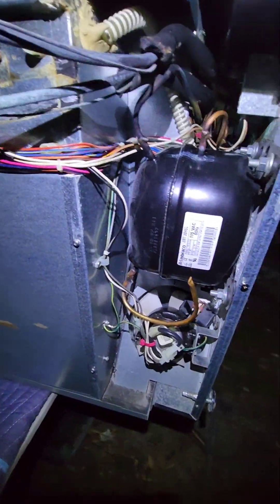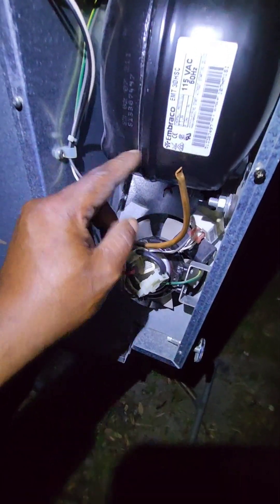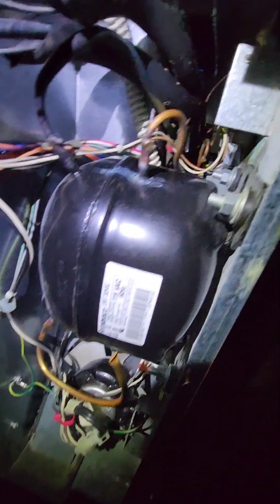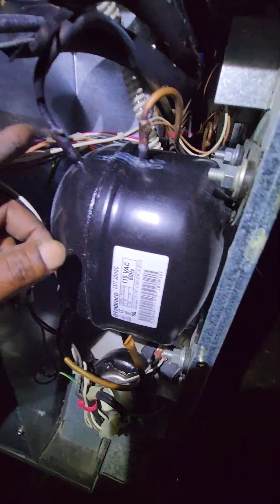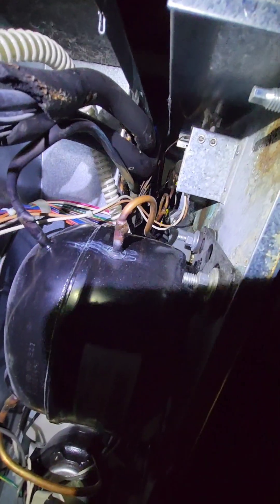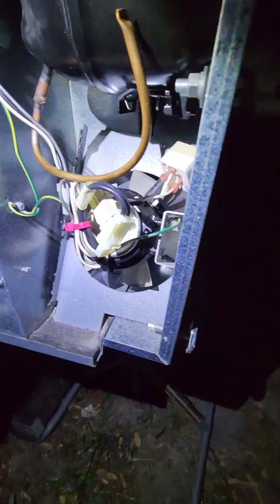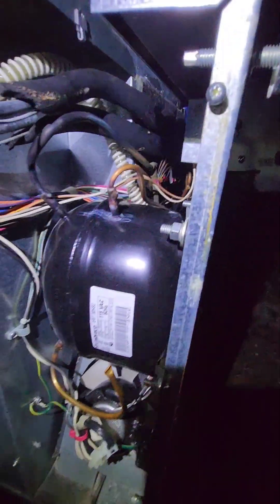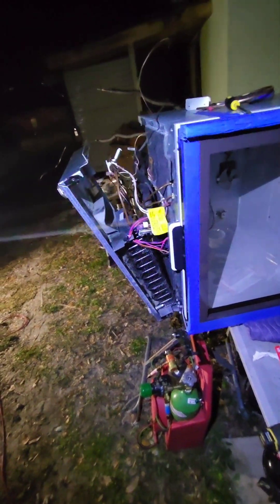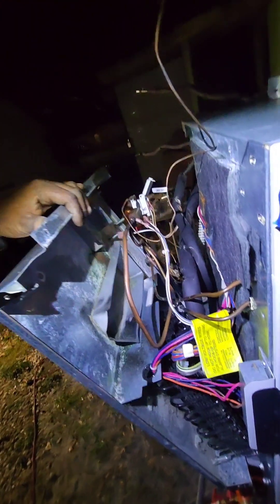You can see I have the compressor — I don't have to worry about oil running back into the system because it's all collected down that side; that's only the process tube. I'm going to solder this out and remove that weight so I can gain better access. Hopefully I can pull this whole bottom panel off and work with everything in there more easily.